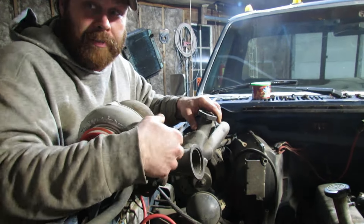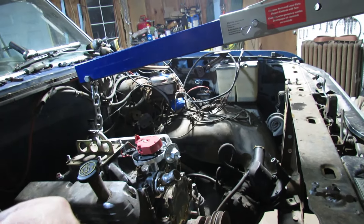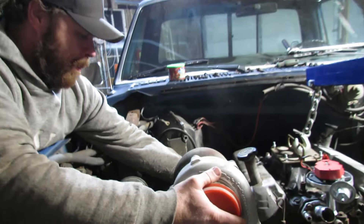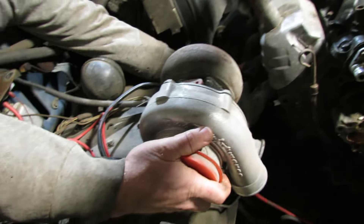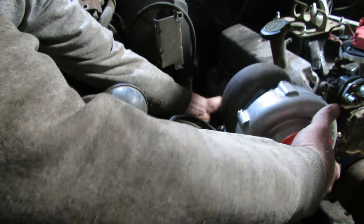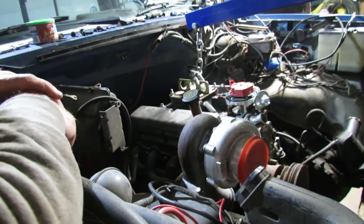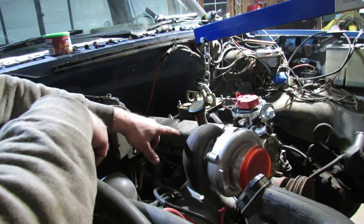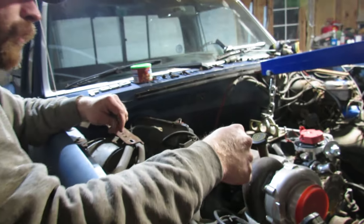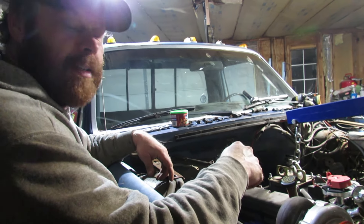This is the On3 Performance turbo kit for an '89 to '93 Fox Body Mustang — maybe '86, one of those — so I'll have to modify it quite a bit for this truck. I've got lots of room in here to work with. These 302s are small but they pack a punch. Not quite sure where I'm going to hang the intercooler yet — I'll figure that out after I get the radiator in. It's a good little turbo. I've got the downpipe with it too, and I think I'll be able to tie into the existing exhaust. It's got a four-foot-long truck muffler on this thing, so you'll hear the whistle but not straight-pipe noise. It's going to be a dually sleeper.